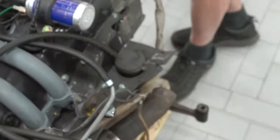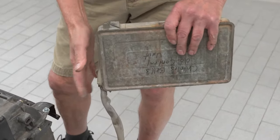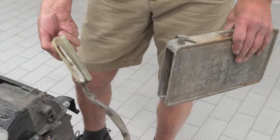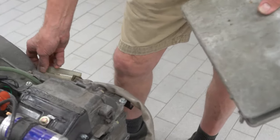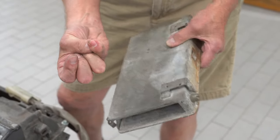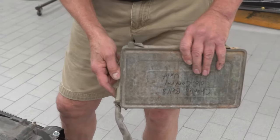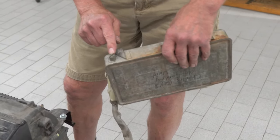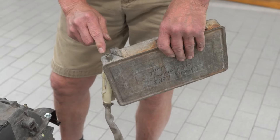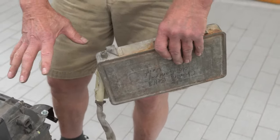Finally, we go over to the control unit itself, which hangs in the front of the battery stand. It has a gray cover — I've taken that off. A lot of people don't think that they can unplug this, but this control unit unplugs right here. This piece, if made today, would be about the size of my pinky instead of this barbaric thing with transistors in it. But it did its job back then and it did it well — it was one of the first cars to have fuel injection. The top knob here is idle adjustment only; it has nothing to do with the running of the car, just idle enrichment. In fact, the early 914s didn't even have one because Porsche thought their mixture was perfect and didn't need adjustment.